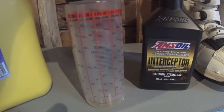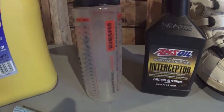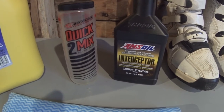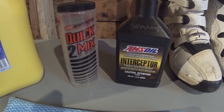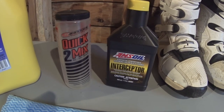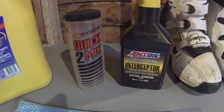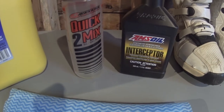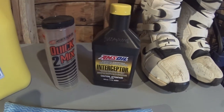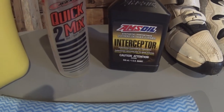On the side of the bottle it's got a chart. This is something you four-stroke guys don't have to worry about — the mix. Some of the newer bikes have oil injection, so they have a separate case for your oil and you never have to worry about the actual mixture. But this bike wasn't designed with that. My 2003 RM125 calls for a ratio of 32 to 1 pre-mix, and that's what I've been using. That helps me make sure I've got the correct amount using the pre-mix measuring system. That's just an extra step in the two-stroke world.